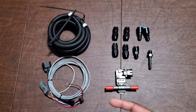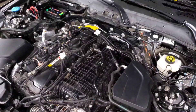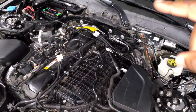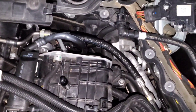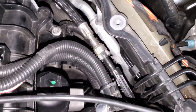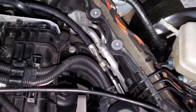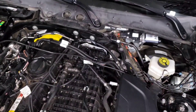I bought the sensor on eBay and a separate Bluetooth adapter. This is my engine bay — I have a 440i with the B58 engine. I took all the trim off the back and found a fuel line that connects from here to here, which is a perfect candidate to replace and have the flex fuel sensor installed. I was originally going to jump into one of these connections with a male fitting on one end and female on the other with a loop containing the sensor, but just replacing that line will be quicker, simpler, and cleaner.